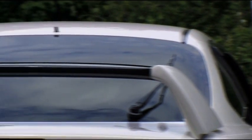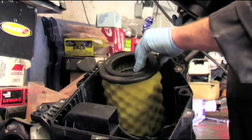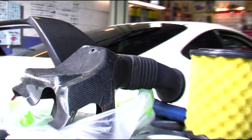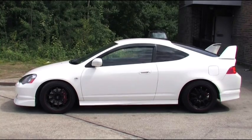Dave has already upgraded his exhaust system and intake manifold. The next area for restrictions and possible potential gains are with the air filter. Modified by TGM, Dave's air box now consists of no internal baffling, a free flowing Spoon air filter, and a carbon fibre cold air ram intake. The first thing to do since Dave's arrived with this modified air box is to put it straight on the dyno.